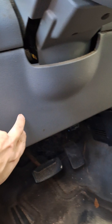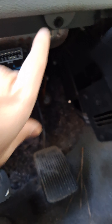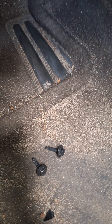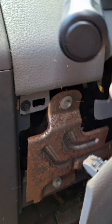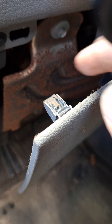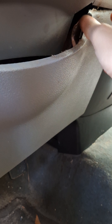Once you have the battery terminal disconnected so you don't have power, come right here under the bottom panel. There are two screws — one right here and one right over here — that are a 7 millimeter bolt. Take those off and then the clips up here will just pull down. We have the two screws out now, and this pops off — you can see there's a wedge-shaped clip here and one on the other side. Pop those off to get to the next piece.